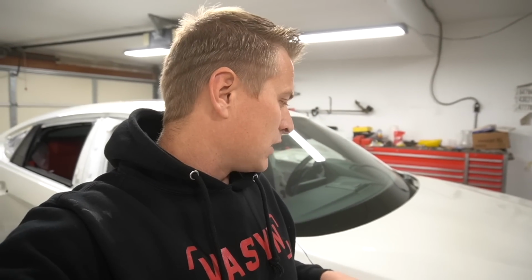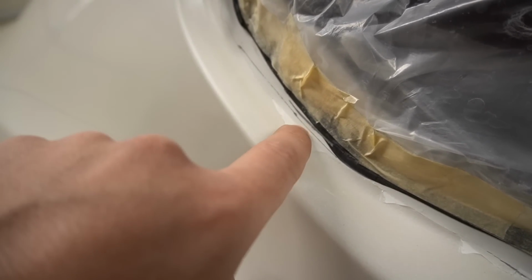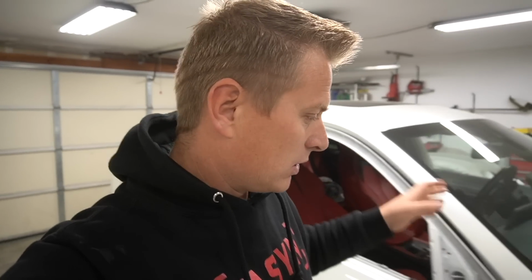There are two theories about what I did wrong. First, I didn't have enough base for the whole car, so I put the GM white underneath the Alpine white, which is actually a way different color. Alpine white is way yellower than GM white. To show you the difference, right here, this is a tinted Alpine white with the pearl. This is the Alpine white OEM color, and the GM OEM color is actually a lot whiter. So first I applied GM white, then Alpine white, and looked until everything was covered.